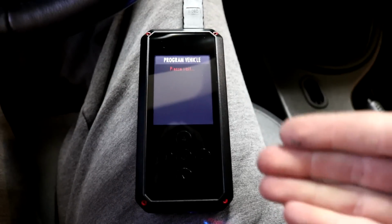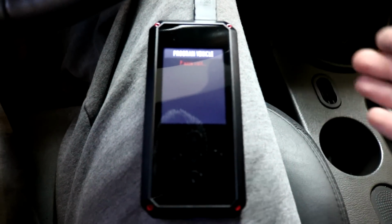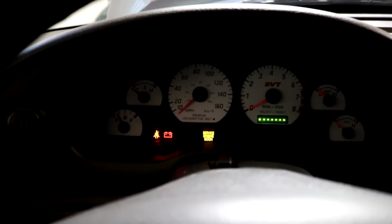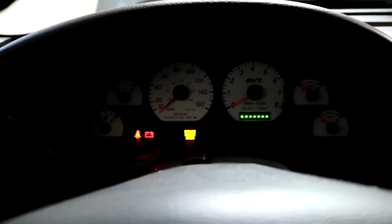I don't know how revised this is, and obviously it's not super accurate because it took them not long to do it, but I'm still gonna put it on and then I'll start it for the first time for you guys. I'm pretty excited and a little nervous. So uploading the Bama tune right now, it does not take long at all. You just gotta turn the key on, upload some files from the cloud which you requested from email, and it's already done. I've done a video on this before. When you're tuning the car, the fan goes on the highest speed possible, and all these lights come on and flash, and when the mileage is, there's these dashes. So you think that something's going wrong all the time, but it's perfectly normal.